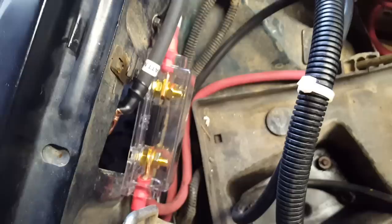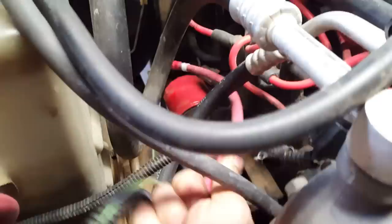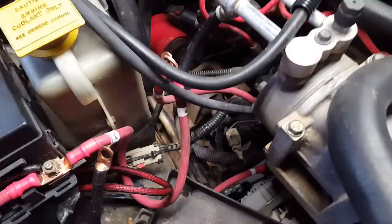Just one wire left. The last cable to replace will be the main power cable that goes to the terminal and battery and runs down to the starter. Mine is kind of tied up here in the wiring harness in the loom and goes all the way back down there. I'm going to get this thing cut apart and pulled out, then we'll go to the starter and see what that connection looks like. I know I have all that wire loom disassembled and pulled out of there — you can follow that red wire all the way back down to the starter. 13mm. Just going to slip the new wire back down there. Following this green wire because that's the factory routing. That's bolted up to the starter down there. I just put that wire loom back on and have things back into their factory configuration.